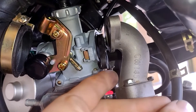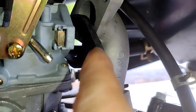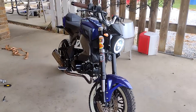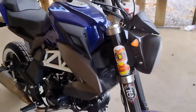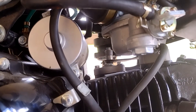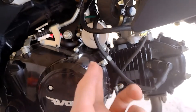As I'm putting my carburetor back in here, I just wanted to mention — don't forget to put this little plastic spacer. Your O-ring on your carb faces the non-O-ring side on this, and then the O-ring on this faces your intake manifold. And as you can see, we've got her running again. Now the moment of truth, because this normally happens when you cut the key off — which it doesn't seem like it's going to. Let's go take this thing for a rip, get the GoPro on, and rip her around the block to see if this fixed it.